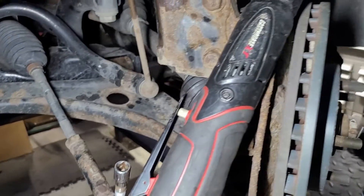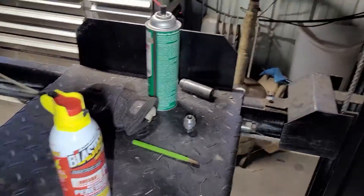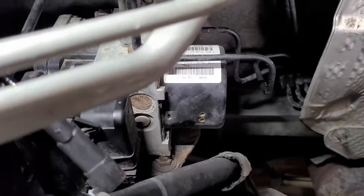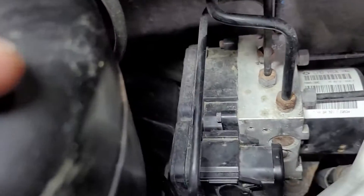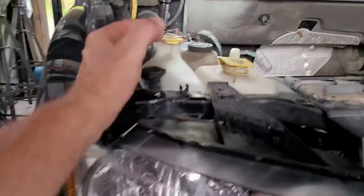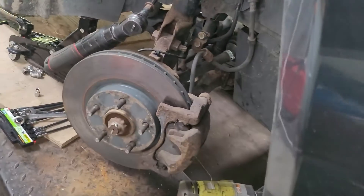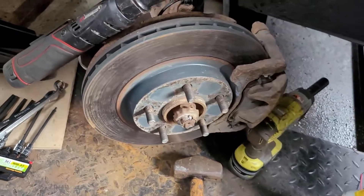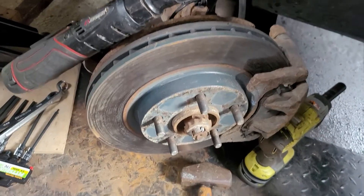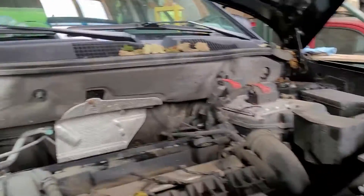It took me a little longer than I wanted because I know that was clean when I put that bearing in. So now I'm assuming that when I pulled out the old pickup and put the new pickup in, I probably pushed a lot of rust and debris down through that hole — and that is a sealed compartment. That's what's causing it to kick on. So I've got to get back on this, get that nut off, get the caliper released, bottom ball joint released, lower ball joint, and then get these four nuts up here loose and it'll drop down so I can put the new one up.